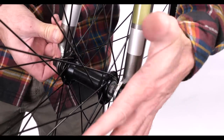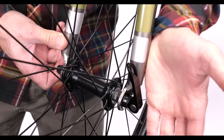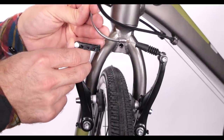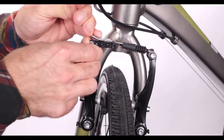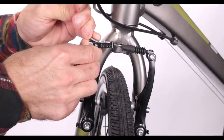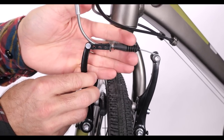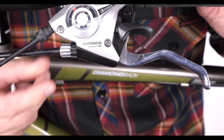The first step is to put your wheel squarely in the dropouts and tighten the quick-release lever. Next, you can start attaching the brake. Grasp the noodle and the right brake arm and push them towards each other, supporting the hinged release. Slide the noodle into the notch, making sure it seats all the way in. Slide over the boot and test the brake.